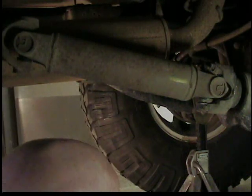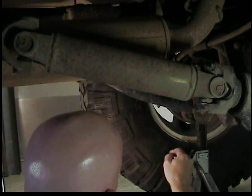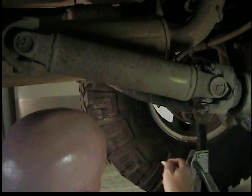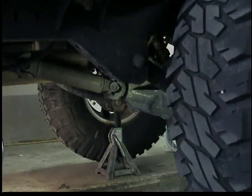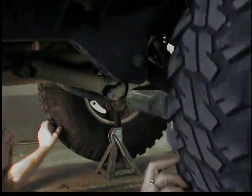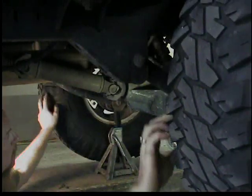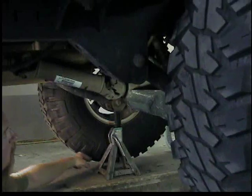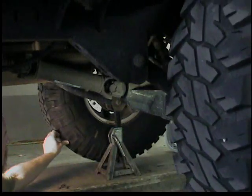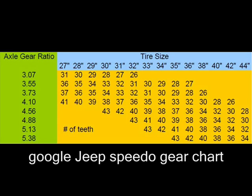The first thing I have to do is figure out my gear ratio in my differentials. So I've marked the driveshaft, and here I'm marking the tire, and then I've got the Jeep jacked up with the rear end in the air. The Jeep is in neutral, so I can rotate both tires at the same time. I'm going to rotate the tires one full turn and count the driveshaft rotations. It's important you rotate both tires at the same speed. One, two, three rotations — coming up on the mark on the tire, there it is. It's just shy of four rotations, so about 3.73s.